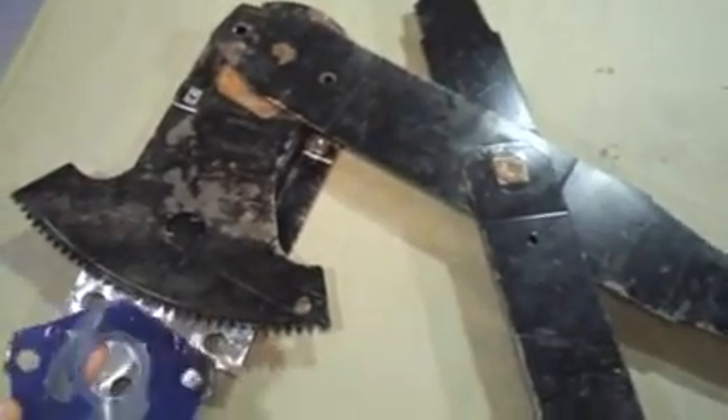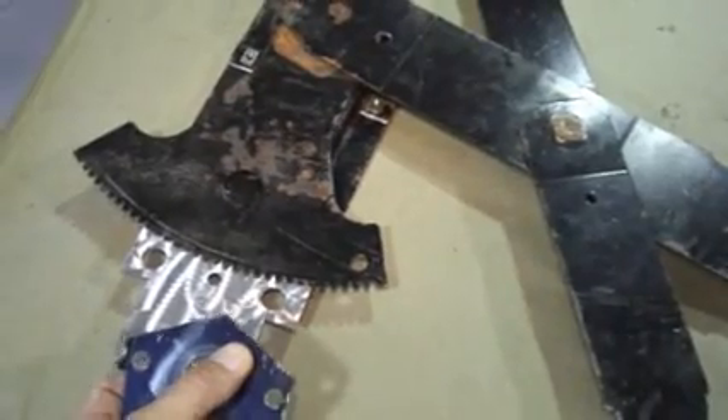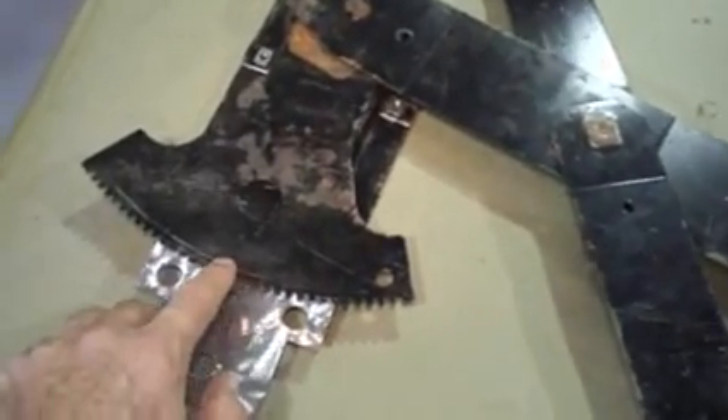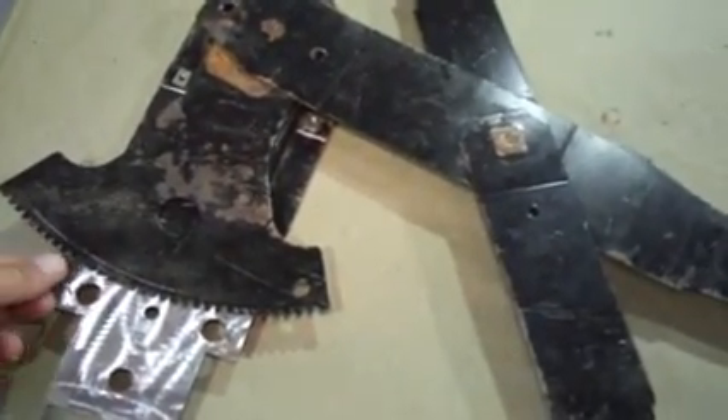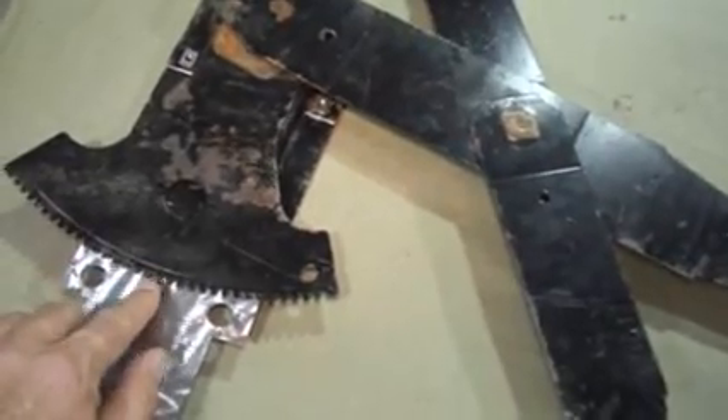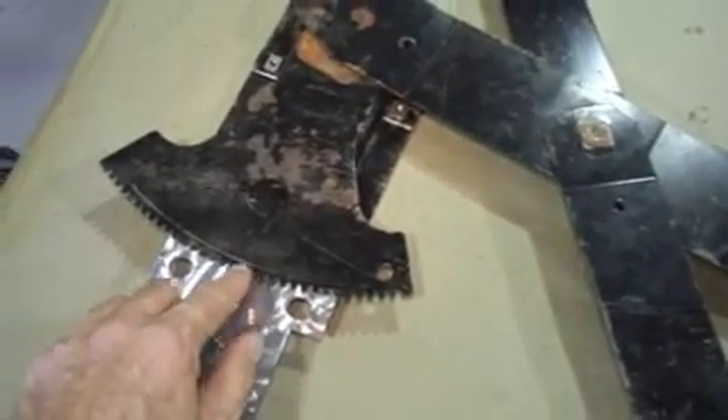What I like here is that we're going to put two little balls on here and peen them in there, like Ford had. You can see where the one has been scraping on there. It's not rocket science, but it just holds it and keeps the motor from slipping out of this track, keeps the gears lined up. Pretty basic but important — we'll show you that too.